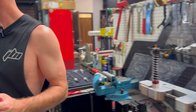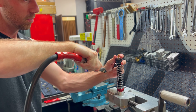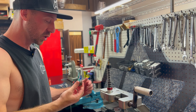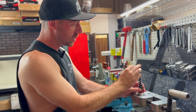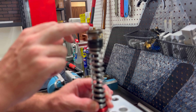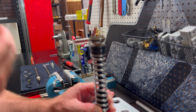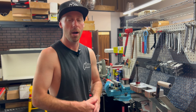Before installing the piston, I'll blast it off with a little compressed air to clean it, and also do the same on our shims. When we send you these shims they'll be very clean, but it's always good to take extra preventative steps. Please check the o-ring around the compression piston — these o-rings don't normally get damaged since this piston is fixed and doesn't move, but sometimes you will see them torn. If that's the case, seek out a replacement. My favorite website is o-ringstore.com, where you can buy every size o-ring you could think of.